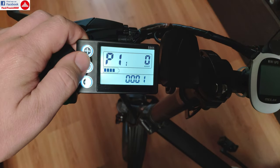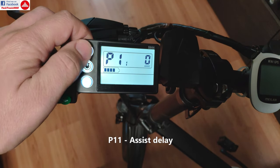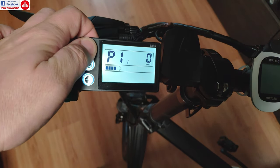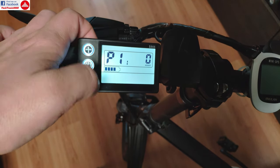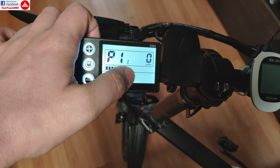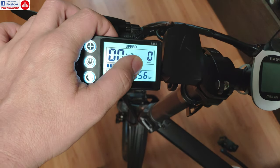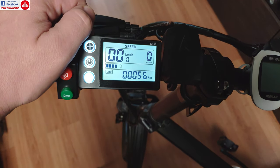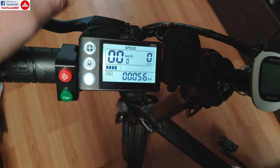P11 is the sensitivity for the assist system. It has 1 for almost no delay and up to 24 levels of delay. This is how fast the bike will pick up the pedaling of your crank. If it's at 1, it will start the motor right away; if it's at 24, it will wait while you pedal, and then it will actually start the motor. This is very useful if you want to save power — you can set that to the highest delay, and then in assisted mode you pedal and put in the effort when starting, and then the bike will run on electric and help you.